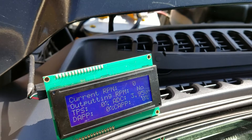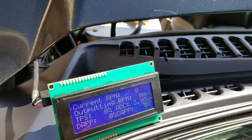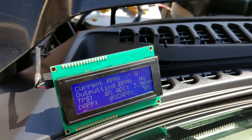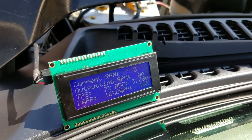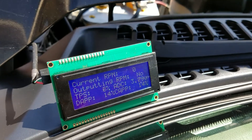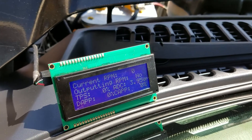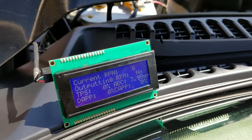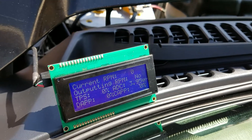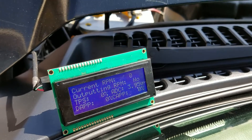As I push the pedal down you can see there's a little gain. I did that initially because the Cummins makes so much more power at lower throttle positions versus the 6.0, so adding a little gain at lower throttle positions helped the 5R110 shift better. I had very good success with that — if you do it one-to-one at lower throttle positions you get some flaring. And mind you, this was without any programming to the PCM; this was just on a stock flash.